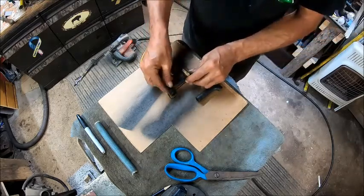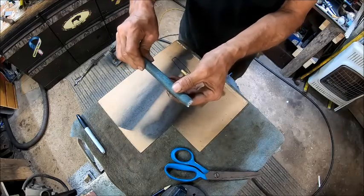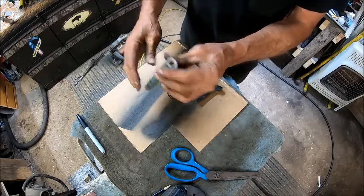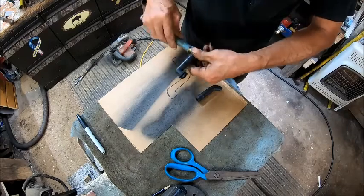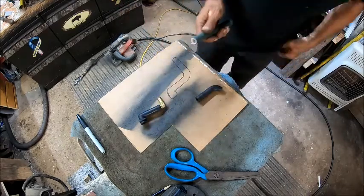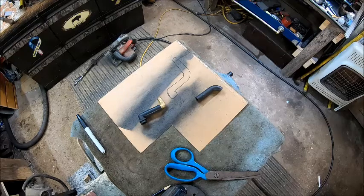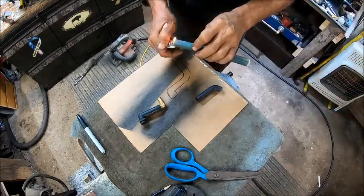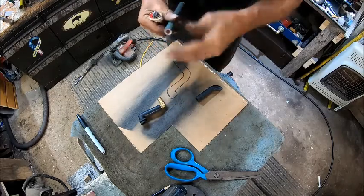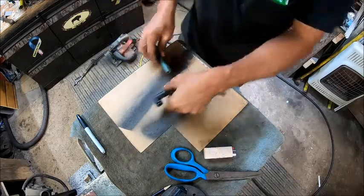And then we're going to turn that around. Now it's a little off, but like I said, this hose will flex a little bit because this is air hose that we're going to use. It's I think 3/8 air hose, and we're going to stick that on there just like that. Of course, I'm going to take my lighter here if the fan doesn't bother me. We'll turn that fan off. We're going to take our lighter and just melt those edges, the white part, so it doesn't look all frayed out. It looks pretty straight. And then we're going to cut that to length.